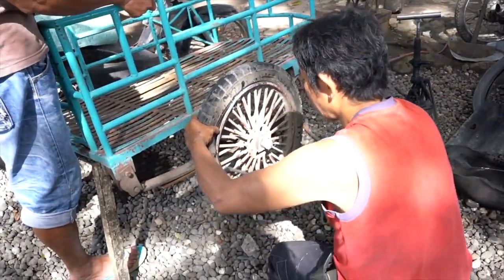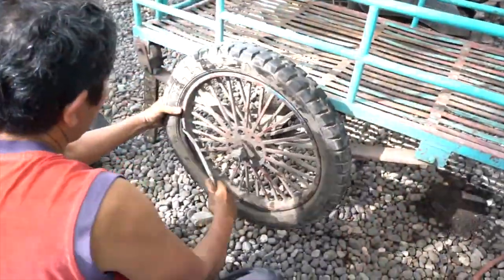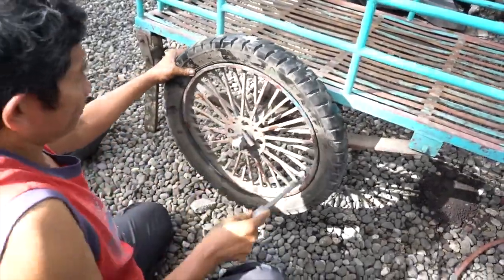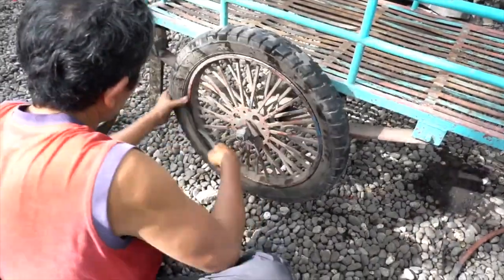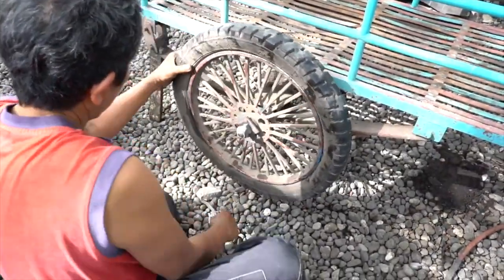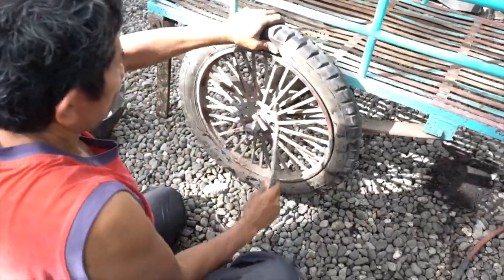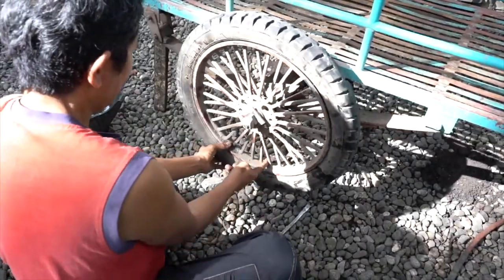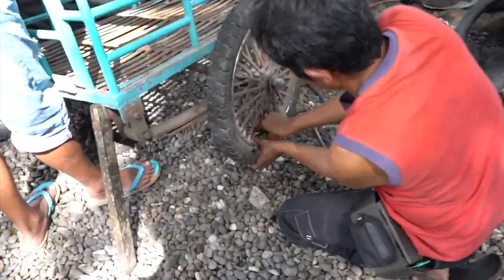So we pry back the tire back onto the rim, being careful not to tear anything or bind our tube. There it is, the last stretch. Home free. Taps on it to make sure it still sounds good. Checks the alignment of the valve stem so it's not crooked. And he starts to put air back into the tire.